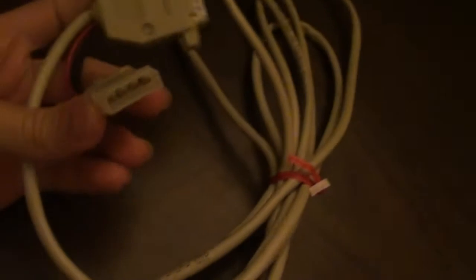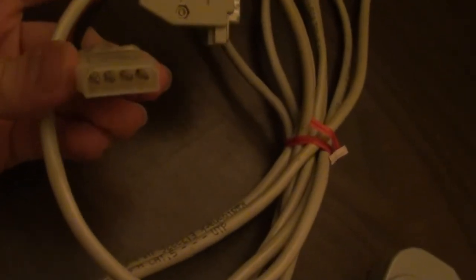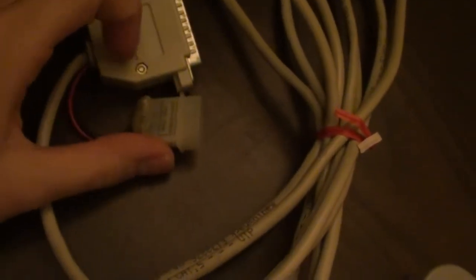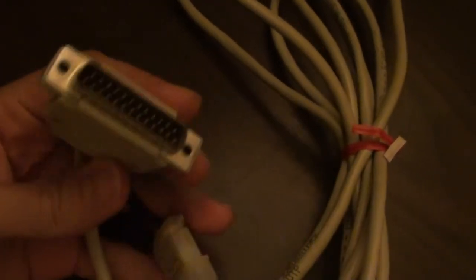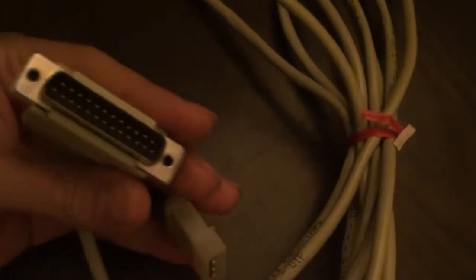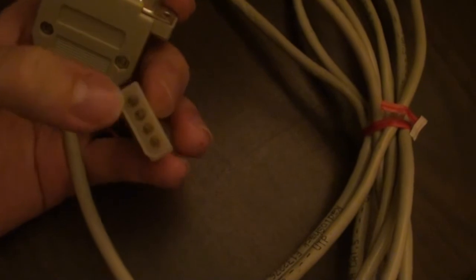This one does not connect to the PC by a USB connection but by a parallel port connection, and also to the PC with a 5 volt power source. USB 2.0, which has the same shape as the older 1.1, actually draws power from the PC. A parallel port doesn't, or does very little - it can draw some power, but this provides 5 volts.